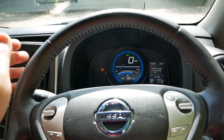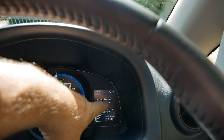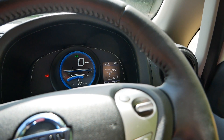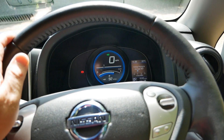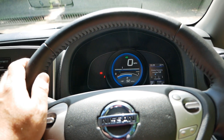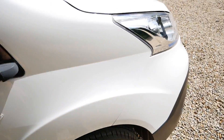Motorway driving is the most inefficient for an EV, particularly on a van like this where there's a lot up top. I was averaging 3.2 miles per kilowatt hour, so not particularly efficient driving. But when you're driving more locally, particularly doing city driving, you're going to get much better efficiency and somewhere between 150 and 180 miles out of this.